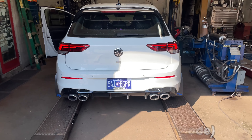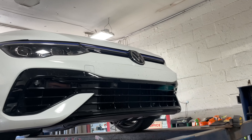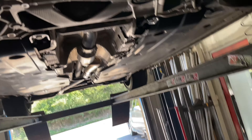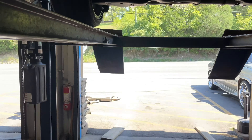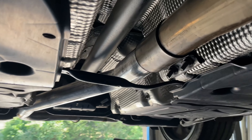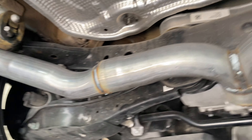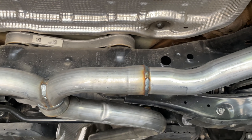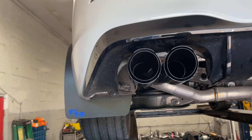Sounds a lot better that way. We'll let you guys hear what we've done. 2022 VW Golf, four-door turbo. What we got done on it: put a high-flow cat there, then ran his original pipe because he wants to reconnect that system if he ever wants to sell it. So we ran just this piece original for the clamp right there, then we ran two and a half inch pipe into a custom two and a half inch Y-pipe that we built in-house, as you guys can see.